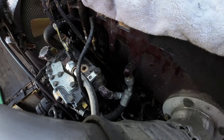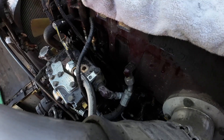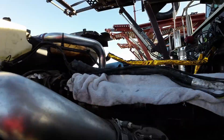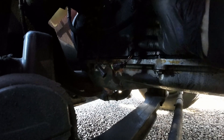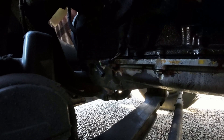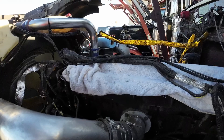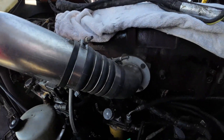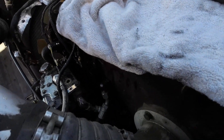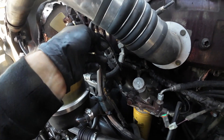That's not a problem. Now I have to reach down and try to unplug the crank sensor — it's all the way down on the engine, so that'll be a little pain. I also put a towel on top of the engine because I removed the spacer and it's all exposed. Always make sure your engine is covered — the top of the rockers and everything — so no dirt comes in. It destroys your cam and rockers. Nasty is normal.